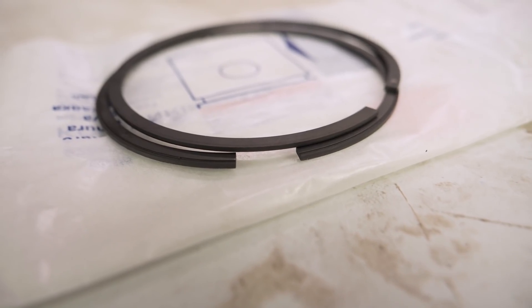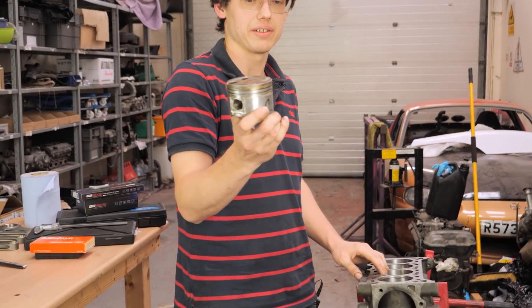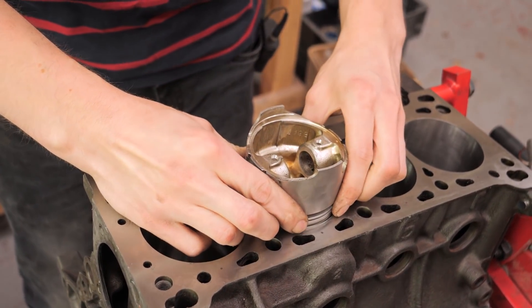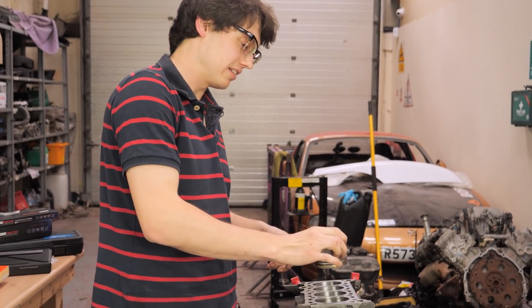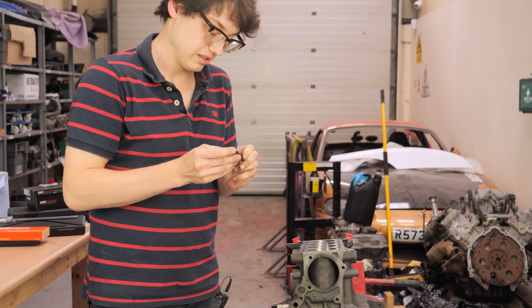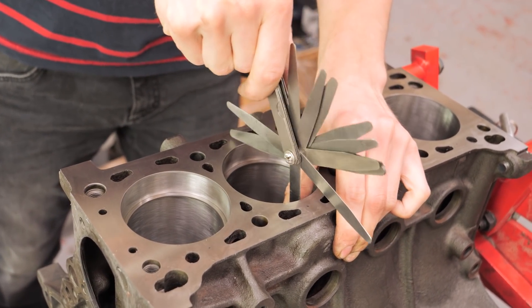To gap our rings we have to push the ring into the bore. Some pistons are pretty flat on the top so you can use it as a guide to flatten. The best way is to leave an old compression ring in the top - that way when you push it down there's a hard stop, no guesswork. We grab our feeler gauge, find our target measurement. This is the top ring so we were targeting 16 thou. These don't need gapping - that's quite a firm fit at 17. So right out of the box that ring is 17 thou on the top, which matches our standard spec, so we'll accept it.